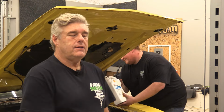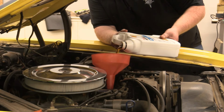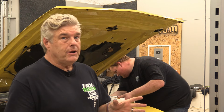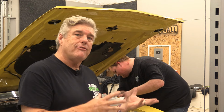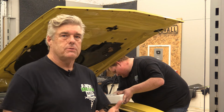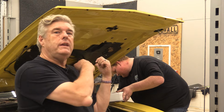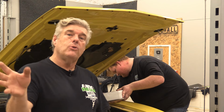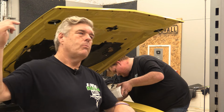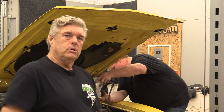All right, while Cam is back here putting the oil in the car, I'm going to talk to you a little bit about a couple of neat things on the 351 Cleveland and the Cobra Jet and Boss 351 varieties. The Cobra Jet and the 4V apparently and the Boss 351 all got baffled oil pans, but they were also a 6-quart fill, so you got more oil. When you're doing these, make sure you set your fill up correctly. Otherwise, you might not get enough oil in them if you've got a 4V 351 Cleveland, Cobra Jet, or the Boss 351. He's putting oil in it.